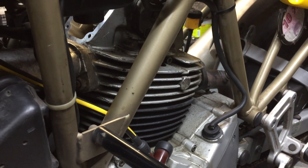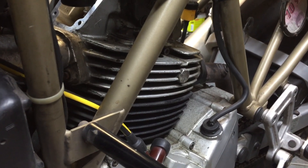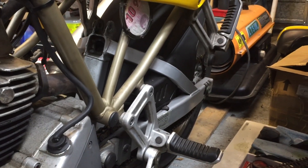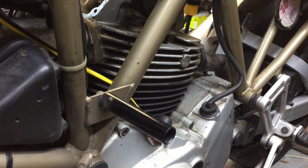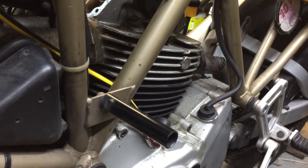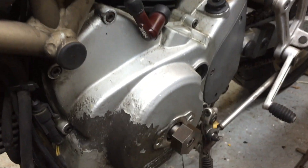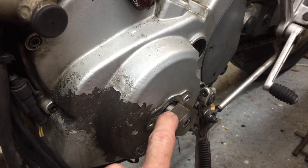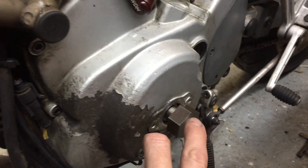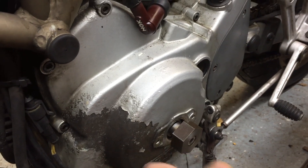To check your valve clearances you need to be able to turn the engine over, and there's no physical way of doing it once you've dropped the shock out — you can't turn the back wheel over and the drive chain to move it around, and there's no nuts on the timing side to get a spanner on. I had a look on the internet and discovered there's a tool that you can get — I think they sell them on eBay as well. What you do is take the generator cover off, and then at the end of the shaft of the generator there's a threaded hole and two little slots for this handle to go in. So it goes in and screws in.